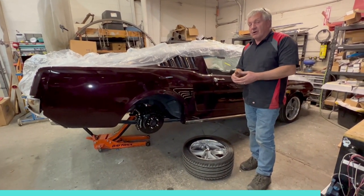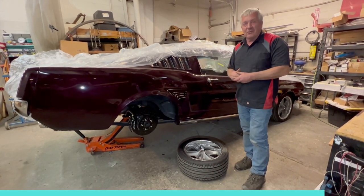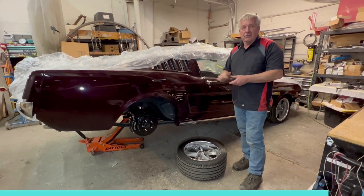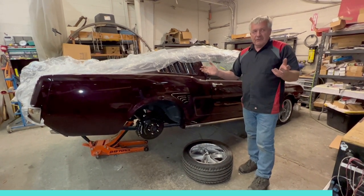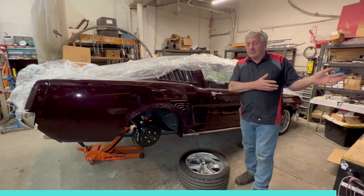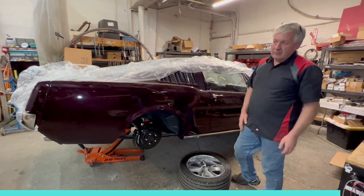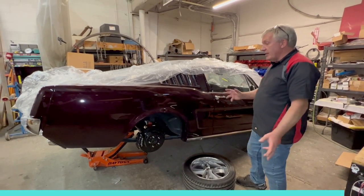And if you're an aggressive driver, if you like to brake late, take your car to the Tail of the Dragon or some nice winding country back road, those are great to have under your foot when you're slowing down. So that's really the difference — you can get away with a lot less with just a front disc brake upgrade, or you can go the whole way and do basically a competition brake setup. Those are your options.